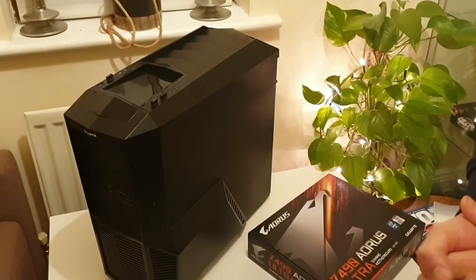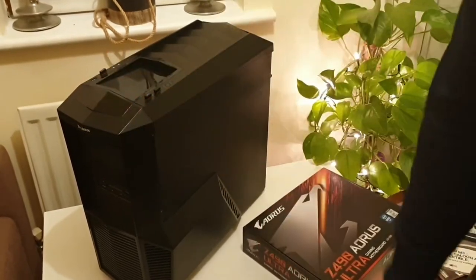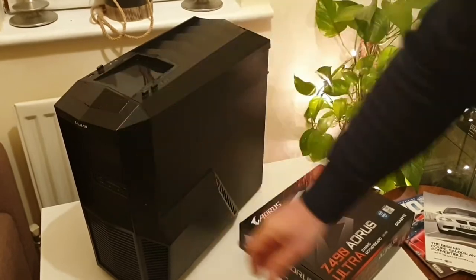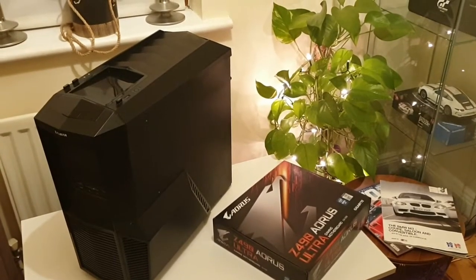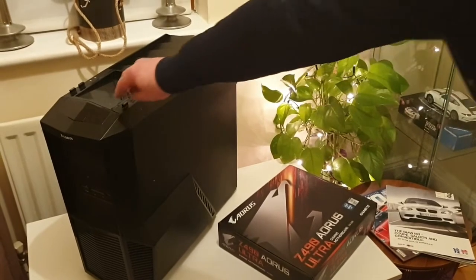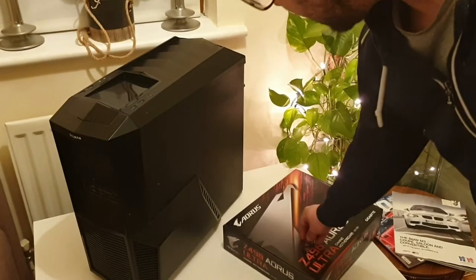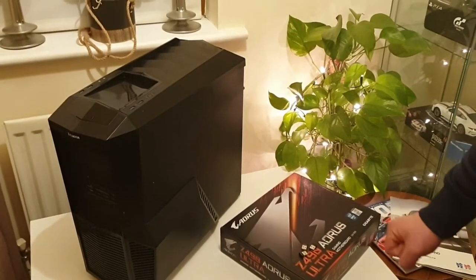For example, you just built your computer and found out that it doesn't show any response when you press the power button. First, what you need to do is unplug all peripheral devices like mouse, Wi-Fi, keyboard, USB, and any others you may have. We had a similar problem when our PC wouldn't start because of a faulty keyboard.